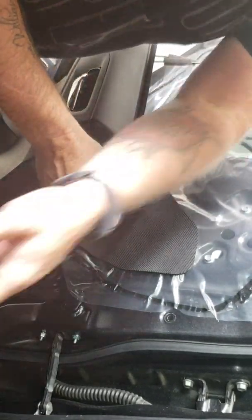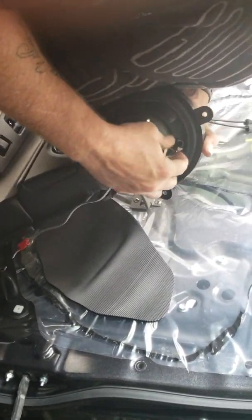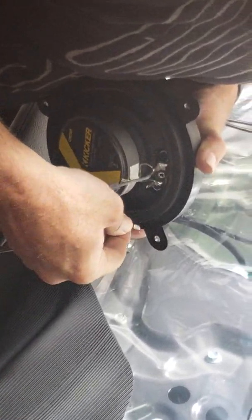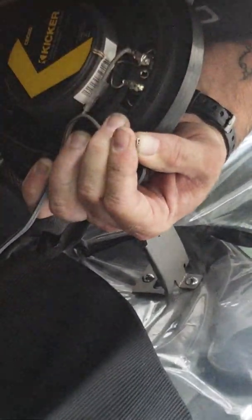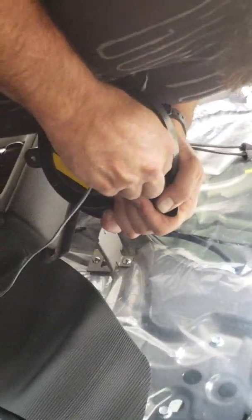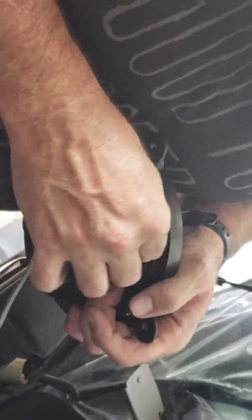Check your connectors to make sure they're open. With the Kickers there's a big tab and a little tab so you really can't mix them up. Slide it on - be careful not to bend those tabs too many times because they will break off and you'll be in a world of hurt. If it doesn't feel like it's open enough, get a knife tab in there and push those prongs open a little bit. Sometimes a little wiggling, coercing, and finessing helps get things on - they're pretty tight so they shouldn't just come off.